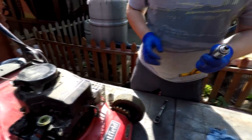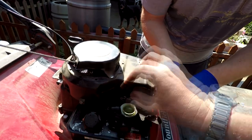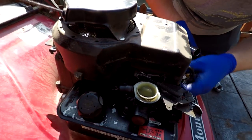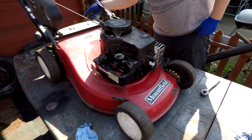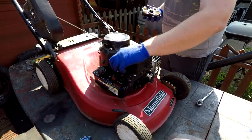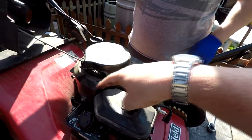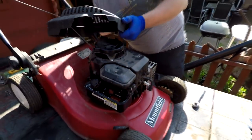Checking the plug - the colour's okay, the plug can go back in. Everything here looks fine. The governor arm has been put back and it's all moving freely as it should do. The rubber boot has been put back on there. At the end we'll just lift up the deck and make sure everything's sound underneath, and that will complete our repair in probably about 15 to 20 minutes. One telltale sign of people playing about with these lawnmowers themselves is they put the air filter around the other way - the design of the recoil cover lid is designed around the angle of that, and a lot of people put it around the wrong way. It's just a telltale sign that someone's been playing about with it.